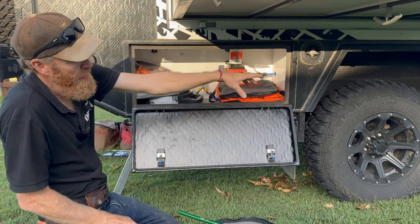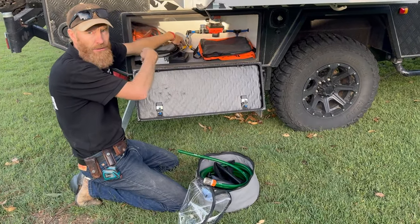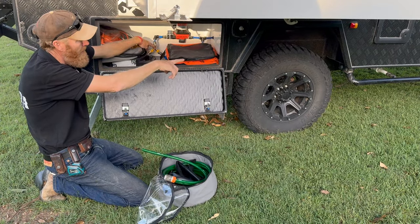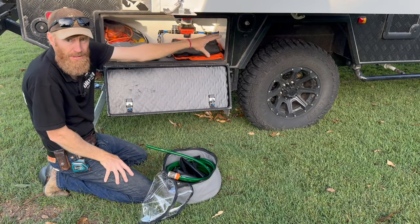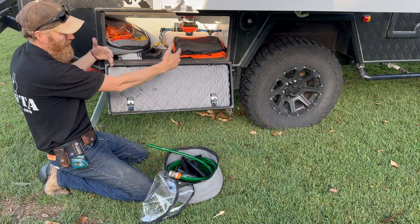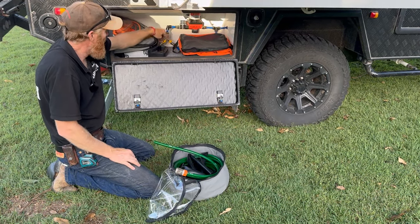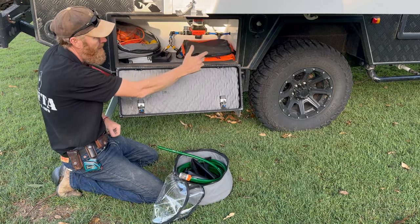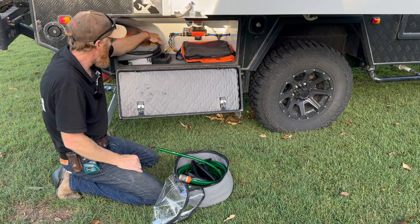The other thing I've found too is if you dump this water, it's all going to end up in your grey water tank, okay? What you don't really want to do is fully empty your grey water tank and then fill both tanks at the back, because you're going to transfer a fair bit of weight at the back. So I'd hold your grey water tank until you start on this second tank, and that balances the water a little bit. But you've got three tanks, you want to try and balance it as best you can, so you've got that ability to do that.